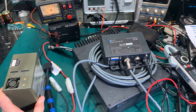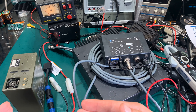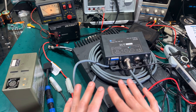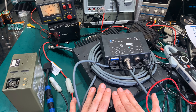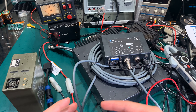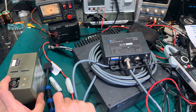You might ask yourself why I chose that one, when you can clearly see on my other videos that I'm using a newer generation lithium-ion. The answer is pretty straightforward: the lithium-ion has a higher voltage — 16.8 volts when fully charged — and that's clearly too high for a 12-volt system. We definitely don't want to blow our quite expensive radio, and they might have over-voltage protection, but Kenwood is a good company — just do not try this.